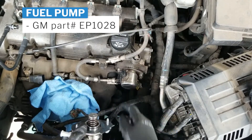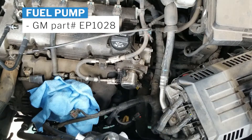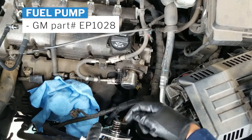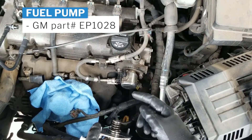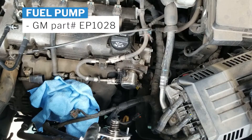I don't know if you can see it on the camera, but there's the gasket. And this is where it plunges — see this part? I can't push it, but in the camshaft, the camshaft has a lobe that keeps pushing the plunger so that fuel can pump through.